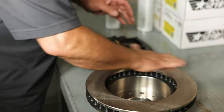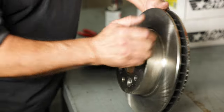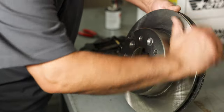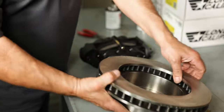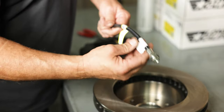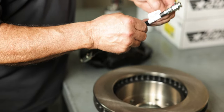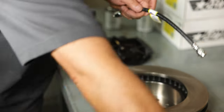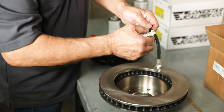I always clean the surface that the pads will sit on with brake cleaner. You don't have to do the hat or the inside part — I've already done this one, it's nice and clean. These are the new hoses; we've done all four of them. Paragon part number 6024 for the front and 6025 for the rear — made in the USA by Americans.